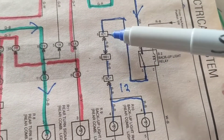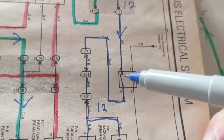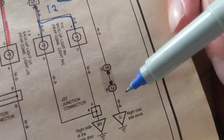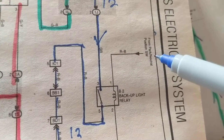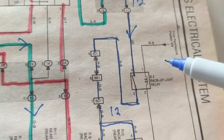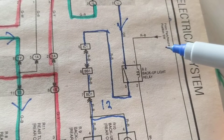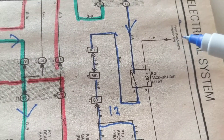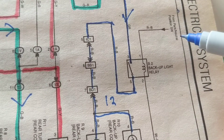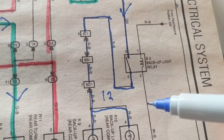Current flows in this path, splits up and goes here and here. In order for this to happen, the relay coil has to be energized. The problem is: where's the B-plus? We know we need a ground. If you look over here, it says 'from park neutral position switch.' When we're going in backup, we're not in park or neutral — we're in reverse. The computer checks for this, and when it's in reverse, it gives a B-plus signal.